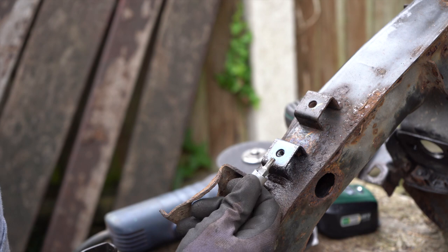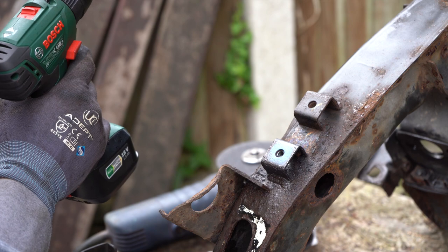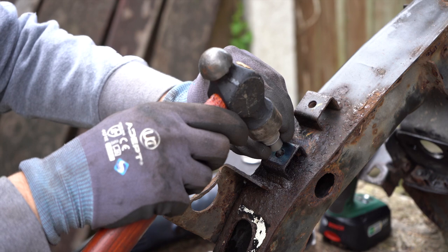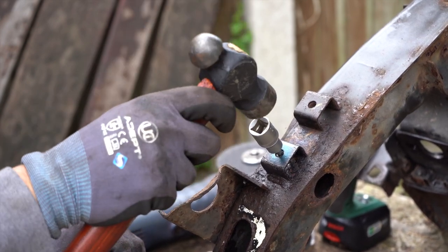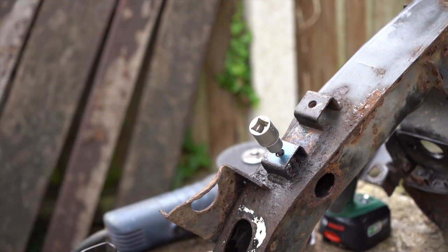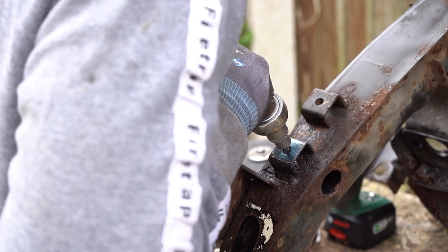So one thing I really didn't want to have to try was the Torx option. Now I've seen people tap a Torx bit into there and it brings it out. So I'm going to give this a go. And just for reference, the last drill bit I sent through it was a 4.8mm. And this is a T30 Torx, just in case you ever attempt this yourself. Now, I am under no illusion that I've probably just lost that Torx socket. And it may snap off in there, but I am running out of options. Nope.